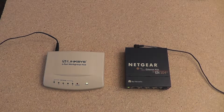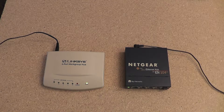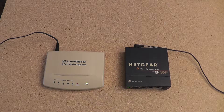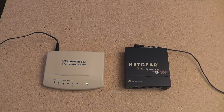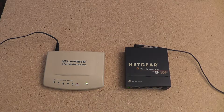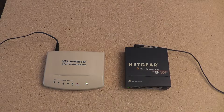As we continue to look at the basics of Ethernet, we're going to take a look at a couple of lower-level devices — Ethernet hubs. Hubs are talked about early in chapter 4 and they first appeared when 10BASE-T started to become the most popular networking standard. 10BASE-T used twisted pair cabling and networks were arranged in a physical star, which meant you had a device at the center and all devices connected to it. It used the most cabling, but allowed for easy additions, and if a node went down it didn't crash the whole network — though if the central device went down, you lost the entire network.